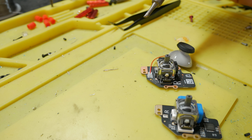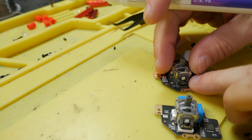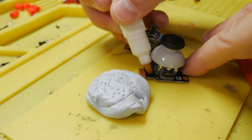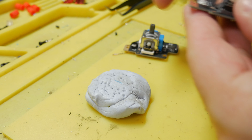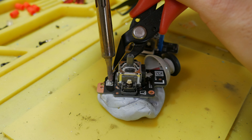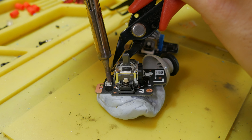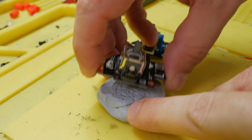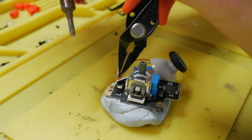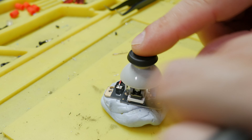We're over here at my soldering station and I have my iron ready to go. If you're doing this step — and mind you, it is completely up to you whether you want to go through it or not — I'm going to put some flux on that; a little flux will get that ready to be heated up and good to go. This is just a feature the Steam Deck has. If you want to take advantage of the touch sense where it's sensitive to your fingers touching the sticks, you can operate just fine without this, but I wanted to go through the process for those who may want to do it. We got that disconnected from the old one. I can't reiterate enough that this is purely optional — if you don't have a soldering iron and you want to upgrade this, that's fine. You do not have to do this part.